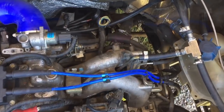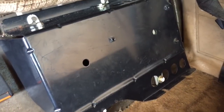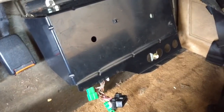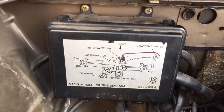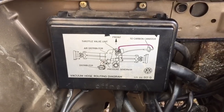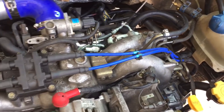It's got a couple other codes but it looks like we're good. I installed the computer in the stock location with the stock housing - just had to bend this flap down. Here's the OBD2 port and the test connectors, and the code killer sits right in there so the CEL check engine light is available. Here's a shot of the ECU and relays. The wiring harness goes through the original grommet and runs back to the black box. I also put the tachometer fix module in here so that you don't have to modify the tachometer itself. Filled up the coolant and bled the system - now we're ready to rock and roll.